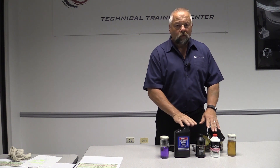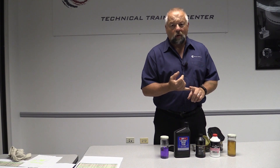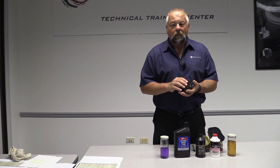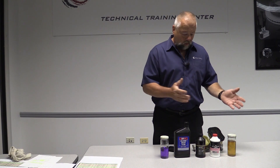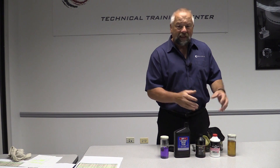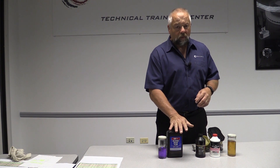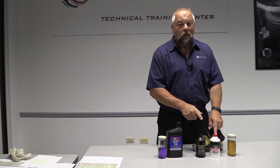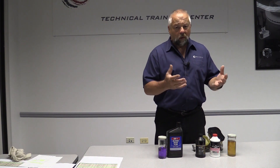The type of brake fluid you use is what's on the cap. If there's nothing written on the cap, use DOT 3 — all older cars that never had anything written on the cap call for DOT 3. In a pinch, if all you have is DOT 4 and your car calls for DOT 3, remember glycol-based brake fluid is interchangeable. Silicone is standalone and cannot be mixed. But DOT 3, DOT 4, and DOT 5.1 are all glycol-based and can be mixed in a pinch.